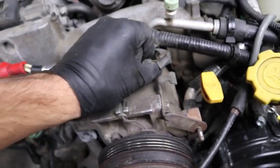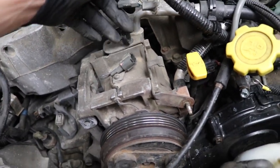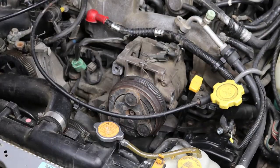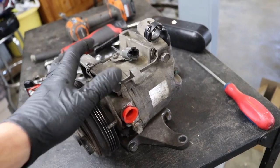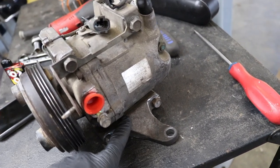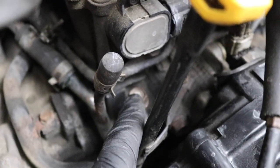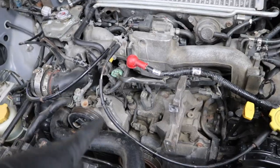Don't forget to disconnect the magnetic clutch electrical connector on the AC compressor and unclip the alternator harness off the top of the compressor. Outside the car to clarify: two bolts up top, two on the bottom. There's also one bolt mounting the bracket on the side — a 14 mil right in front of your TGV housing. Just use a big long extension coming down from the top and you can zip it right out.